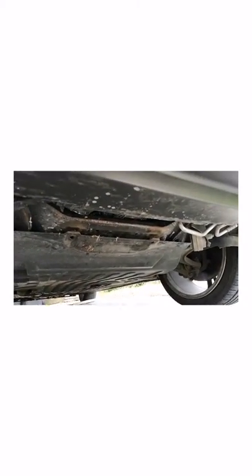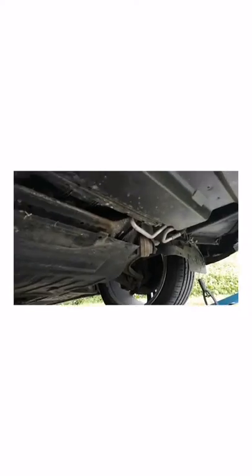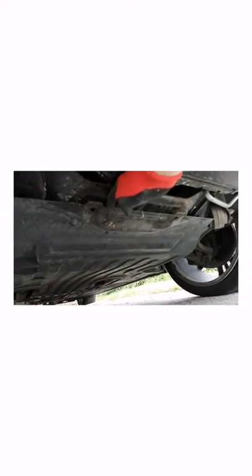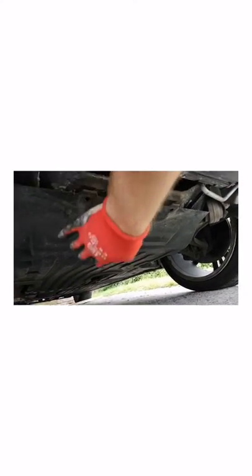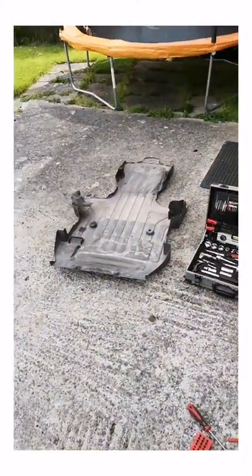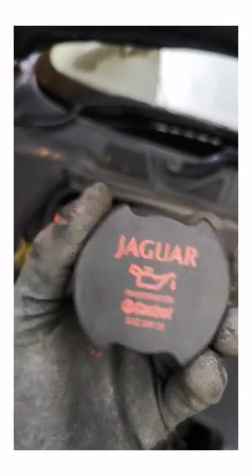I've taken off the first belly plate, which had a series of screws and bolts. However, what I did realise is you don't actually have to take the front one off first. All you have to do is loosen two size 10 screws, take them off, and then you can literally slide that back belly plate out and get access to the sump. So you'll save yourself a lot of time not taking off the front panel — I thought I'd just share that. So the belly plates are off now, front and the big one at the back. You take off the cap which indicates what you've got to put in — the 5W30 for high performance engines.